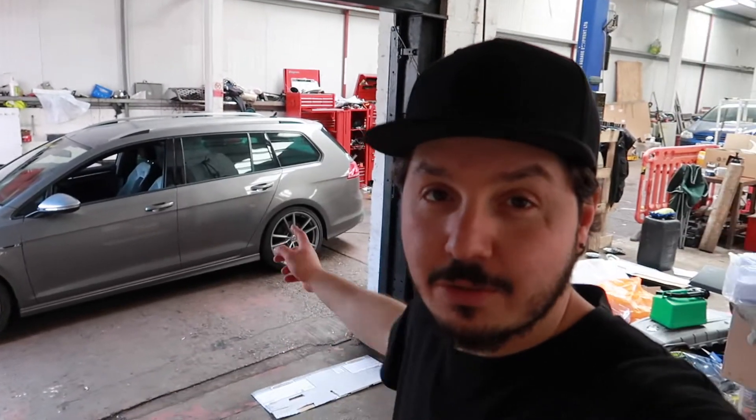I've got to go because I've got a baby shower to go to, but the car is half done - we've done the rears. Big thanks to Milan for giving me a hand. However, the fronts are now even higher compared to the rear, even though the rear still needs to settle a little bit. So we're going to do the fronts probably tomorrow or the day after. It was a bit of an arsehole getting the springs out of the cups, but those hench spring compressors just made light work of it. I'll see you guys when we do the fronts.